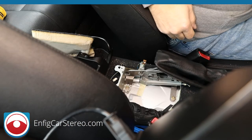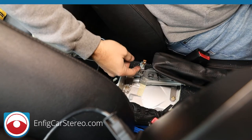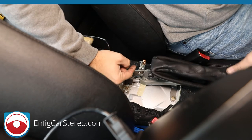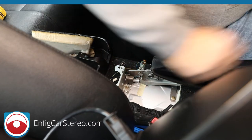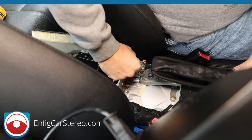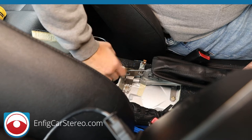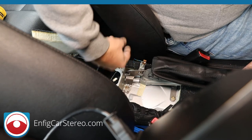All right, guys, here it is. Finally, the parking brake video. Well, lighting's a little off, but it's gonna be quick. So the way this works is that when you pull up the parking brake, you see this wire. It's linked into this. Boom, touches this metal and grounds itself out. Parking brake wire runs all the way up front. Usually, we just take apart the center console and tap in right here, but I found it up front for you. If you guys want to take apart the center console because you're afraid of the wiring up front, this is the wire. It's always a blue with like a brown stripe and yellow tabs.